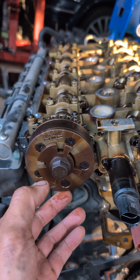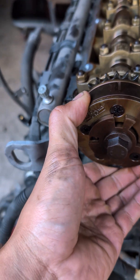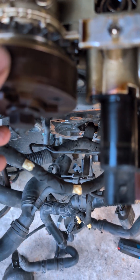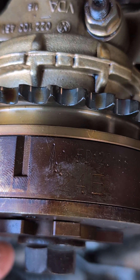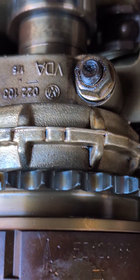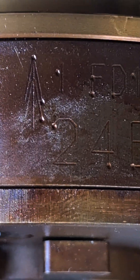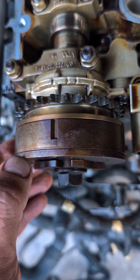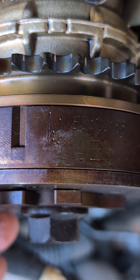Then with the inlet cam, turn it as far left all the way, which then lines up these little marks. There's this little arrow there lined up to the notches — so there are tiny marks on the cam faces. It's a little bit annoying as it's not a big line, but it's this little arrow there that you want to pay attention to on both cam faces.